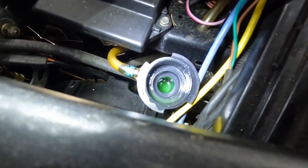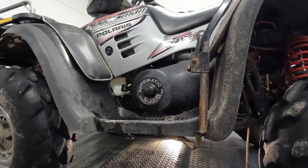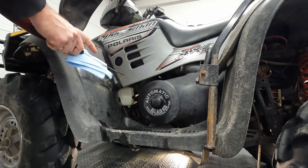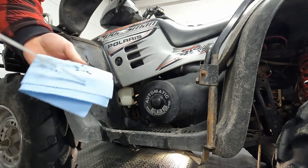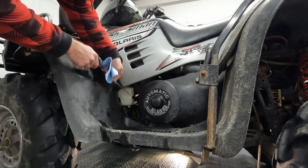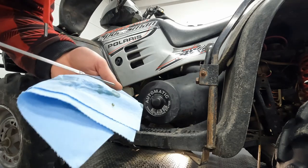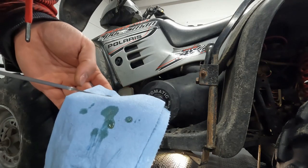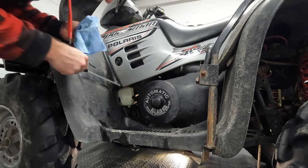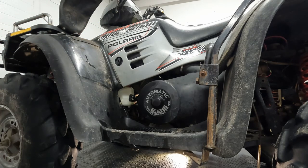The coolant is still green, looks good. The oil level is a little bit high - I'll double check it again to make sure. The oil doesn't really look milky, but I'm going to drain some of it to see what comes out. It's higher than it should be, but that could be because we overfilled it - it might not necessarily be coolant in the oil. I'm going to add a bit of coolant, drain a bit of oil, and see what happens.